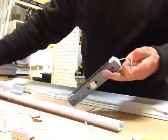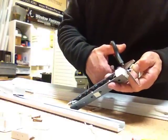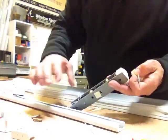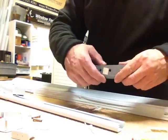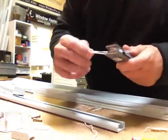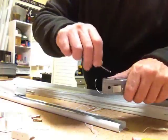First thing we're going to do is cut the cord, cut the tape, and take off all the tension on the spring. So we'll give it a snip. Just make sure your hands aren't anywhere close by when all that's going on. And then we have this mess that we have to fish out of the motor.